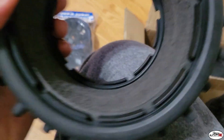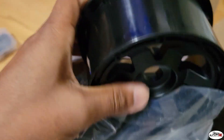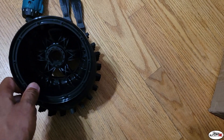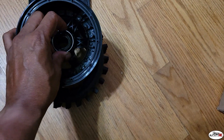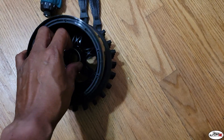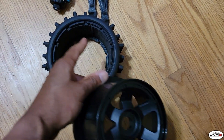Next up, just trying to get this wheel out. That's a Desperado wheel. Don't forget, also in this bag are your rings — those rings right here. You don't need it right now, but this ring here fits right over the top of the back of here, and just tap it down with a hammer, a piece of wood, something like that. Sometimes you can push it down on there and it seats, but don't worry about that right now — just worry about getting the tire inside the wheel.